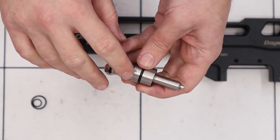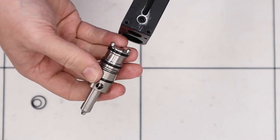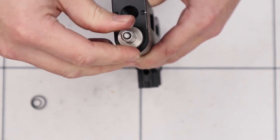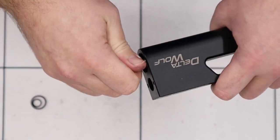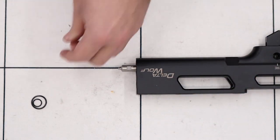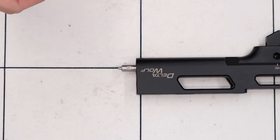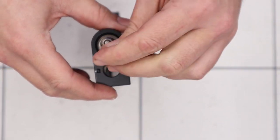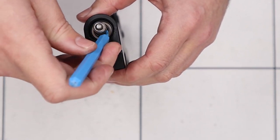First things first, apply a small amount of silicone grease to these three O-rings here. Then, whilst aligning the transfer port — this hole here — with the top of the block, we can push the valve in nice and gently. The valve itself is keyed, so as we push it in, we need to give it a little wiggle just to make sure it seats in the keyway, then check it by trying to rotate the valve. The valve shouldn't be able to rotate once we've got it keyed in correctly. Next, we'll add these two sealing O-rings, and as always, apply a small amount of silicone grease on them before installation. Gently seat them so they don't get torn as we install the retaining nut.